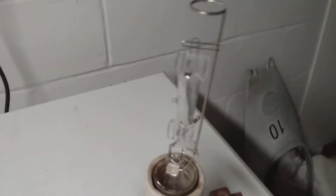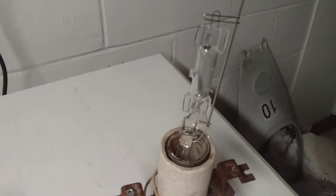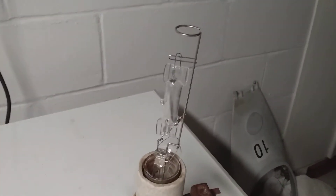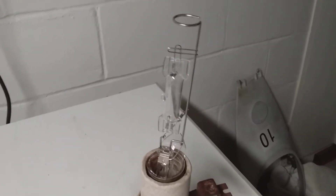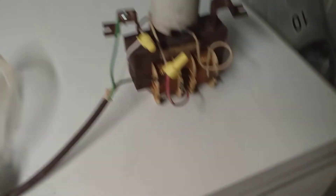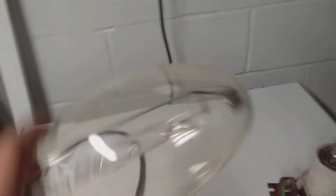So if you leave this running in your room, make sure to have that arc tube clean. Because if you touch that glass tube and try to run it, it'll explode from the oils on your fingers. This will kill all the germs in your entire room without you even cleaning everything, because it releases a torrent of UV radiation. You'll smell the ozone gas — it'll smell almost like chlorine bleach. It's super powerful UV radiation, and it's very good at killing germs. I did a test a while back with a petri dish full of bacterial culture — dead. Mold on bread — dead from this lamp.